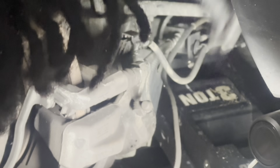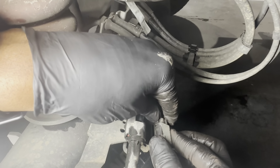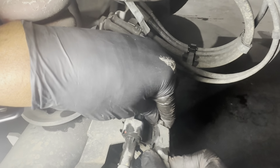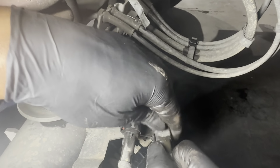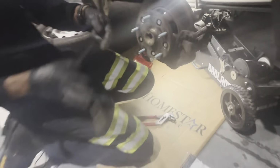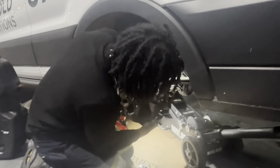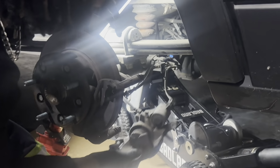and then you just pull off the bleeder screw cap to kind of unroute it, and then there is a tab on this wear sensor deep inside here, guys. You push this tab here, you see me pushing it, and release. There we go. All right, so that's done. And we can take this caliper off now. And it's held by this little doohickey here.